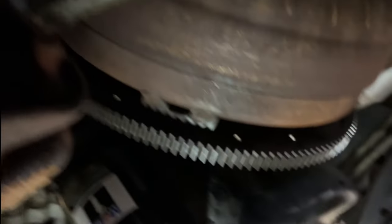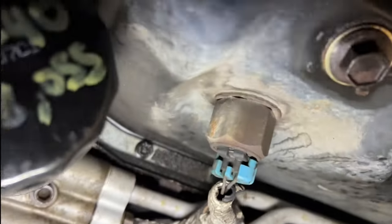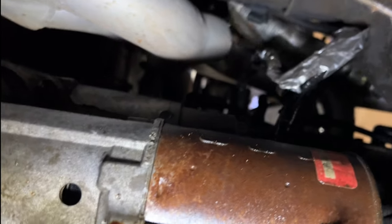Apparently there are four bolts to take off — one, two, three, and four. This one's of course a pain; I've got to get in with a wrench. Knocked that off, pulled the cover off. With the inspection cover off and some light on it, you can see the oil pan gasket over here looks like it's leaking. A few drips here, it's very wet, and the starter is just soaked. That might be a problem.